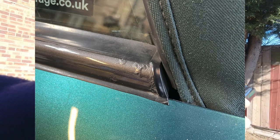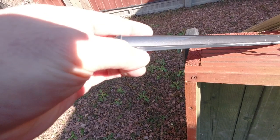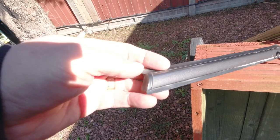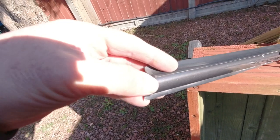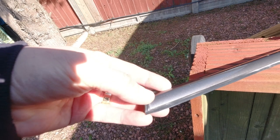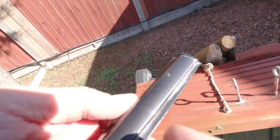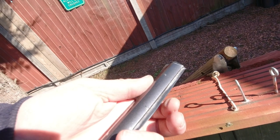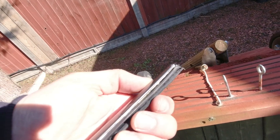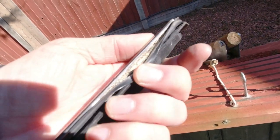This is the rear piece. This end piece is quite complex — you've got the bottom blade and top blade which are part of the main extrusion, and an end piece that joins them together, vulcanized on and tucked over the metal. This short piece shows the corrosion even better — look at the gap here compared to elsewhere. When I pull this back: corrosion.